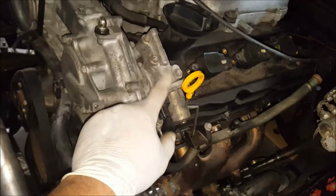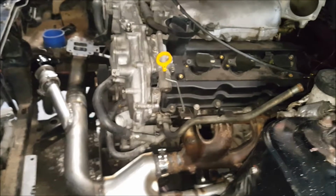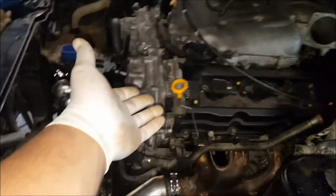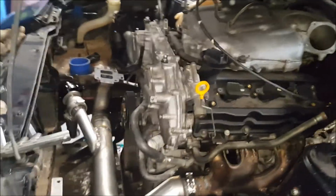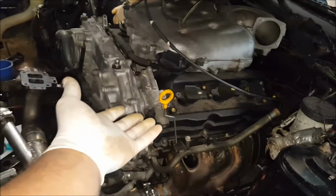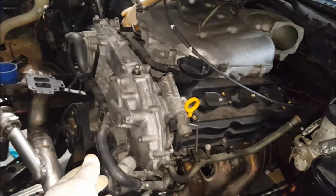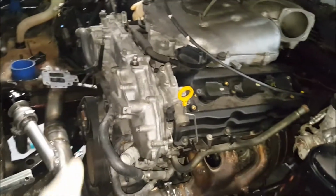But I need to figure out what this VVT does on top, or if it's more on the bottom. VVT, yeah, VVT. Sorry, VVL is variable valve lift. And of course, these are just timing. There are no extra lobes like B16s or B18s. But Hondas were obviously notorious for that because it went from a 232 cam to probably a 258 or something. Rather, in our cars, what I opt to do is just run 264s straight up. You're probably going to lose a little bit on the bottom end, and that's the thing, when you start degreeing cams you can change the characteristics of a motor so well.